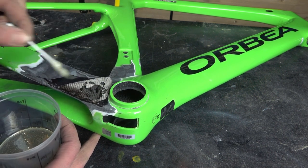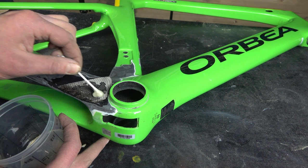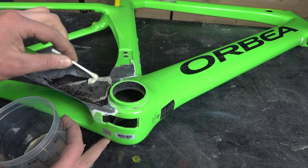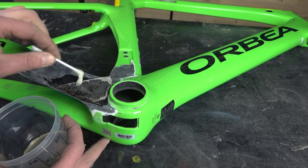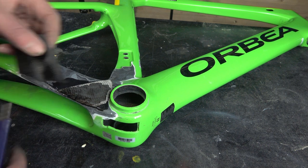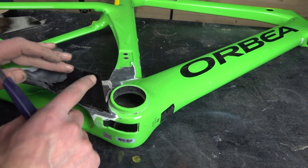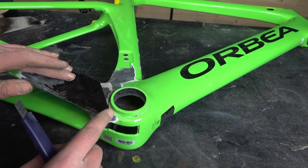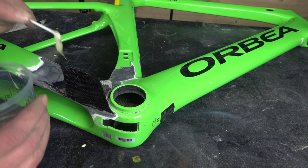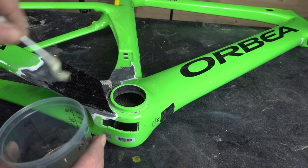And it's no magic. Add some resin in between the layers of carbon fiber. Not too much. You will squeeze it later with some shrinking tape. And that's the cross layer. And I will apply also a third layer on top.